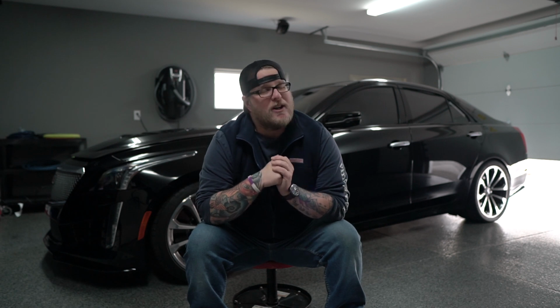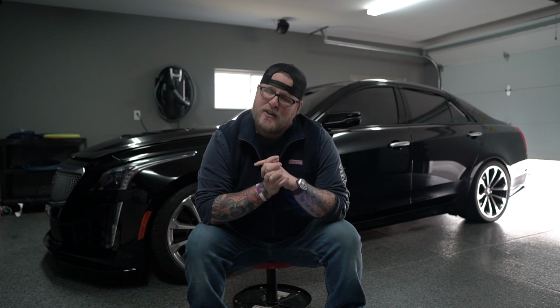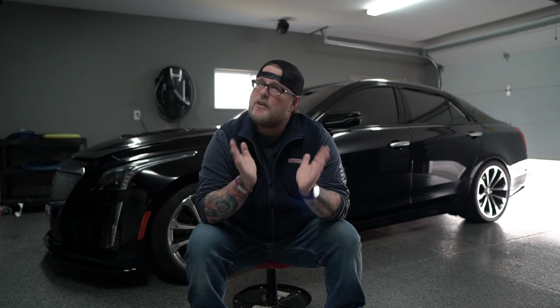Before I did Crown Rally South, I took it to the dealership. They drained and refilled the transmission fluid. That is 20 quarts, which is a lot of transmission fluid. And it did make an improvement. The other thing that is somewhat annoying about this car is that it has a memory for how you drive, meaning it tries to kind of stay consistent with your driving patterns. After Crown Rally South, I got home, and obviously I am not doing the same kind of driving on roads where the speed limit is 35 and there's traffic. So the shift points were way off. And what we figured out after taking it to the dealership and talking to them is that the memory was still treating it like it was on the rally I did. So, transmission not great. You can live with it, but it's definitely not the greatest thing in the world.